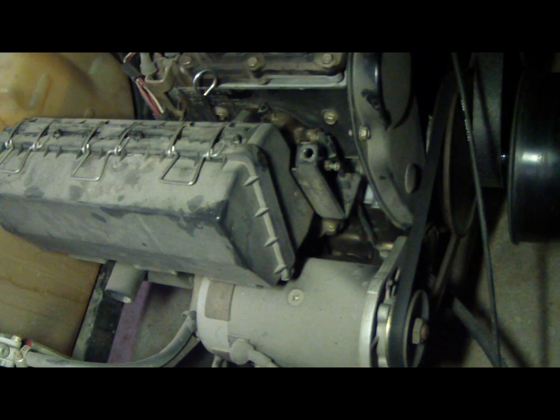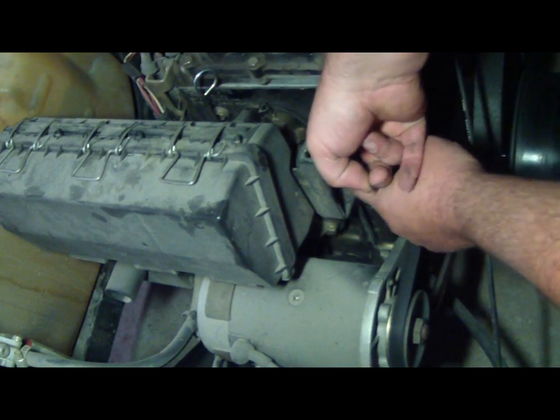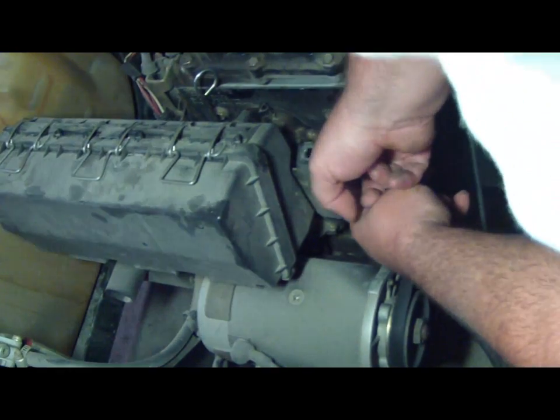Now next I'm going to attempt to remove the throttle cable. Okay, the throttle cable is not fully detached yet. If you can see right here, there's this little clip that you just slide down and pop it off the ball that's on the carburetor. And next I'm going to attempt to remove the clip down here, this piece here with a pair of pliers. Okay, I've now freed the throttle cable. There's the little clip. Fits in the square hole right behind it here.